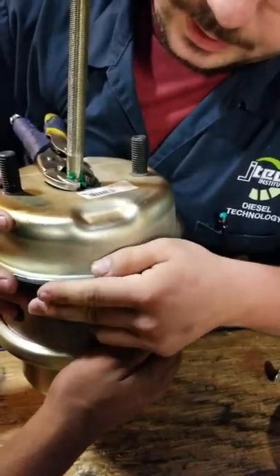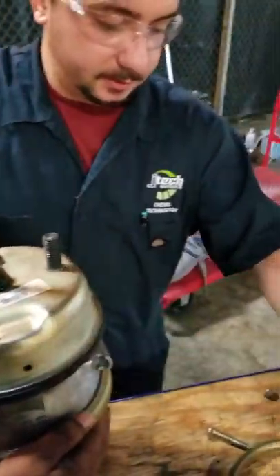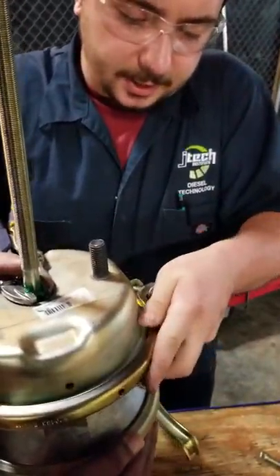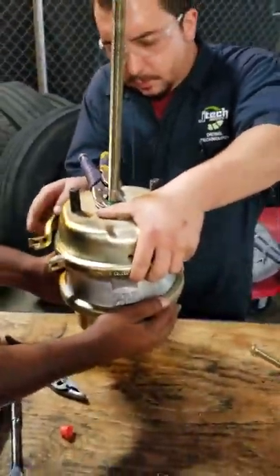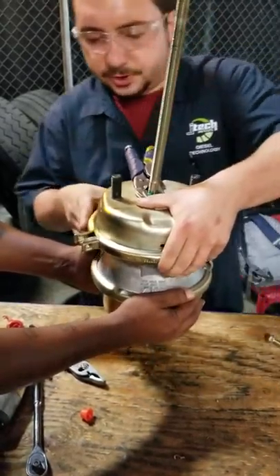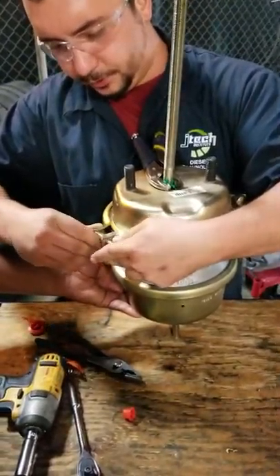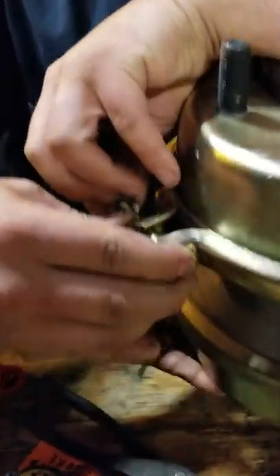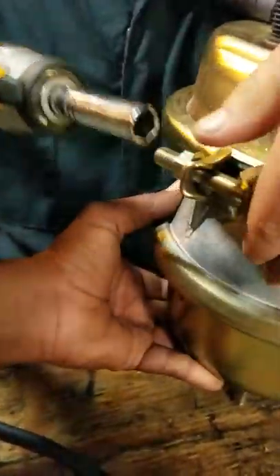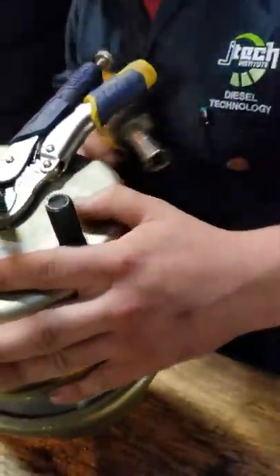It might take a few times, but you want to make sure you get it even all the way around — flush — so that it does not create an air leak later on in the truck. It might take once or twice, but you want to make sure you do it right. It doesn't matter how many times it takes. So now we take our loose clamp and bolt, start one side as my assistant holds it, go around the perimeter of the chamber, and it is set in place. Put your second mount bolt on the strap, start the nut, take your drill, run it up close — very important — you want to make sure this thing goes on evenly.